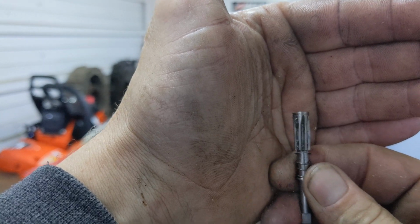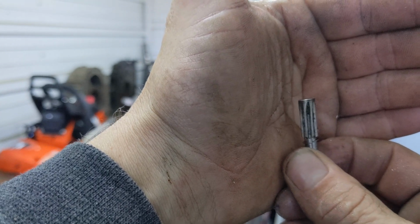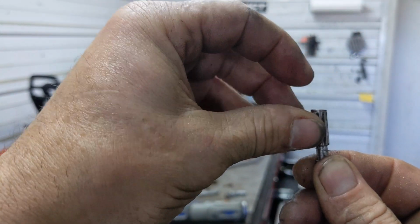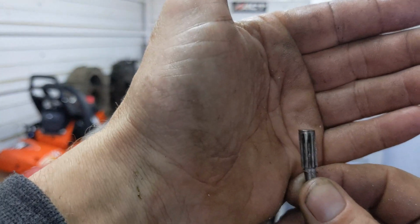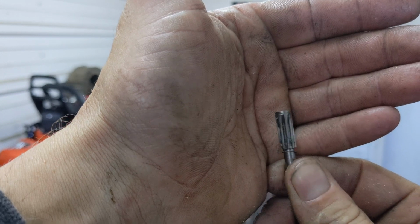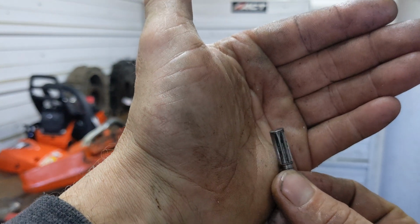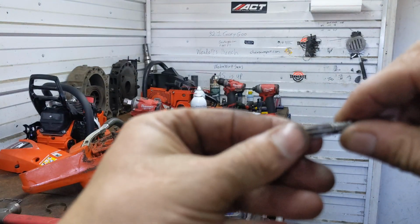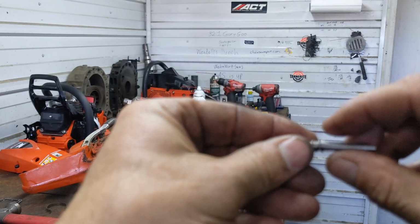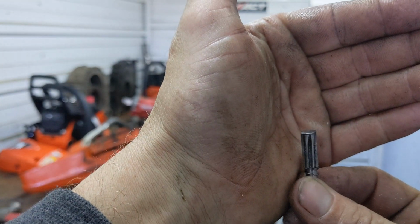take much. Probably turn this into a drinking game if I take a shot every time I say very little does a lot with an oiler. But you want to make sure that taper is super smooth and there's no hindrance on there. So when you put this back together, rotate it with your finger and make sure there's no catches. That has to glide perfectly. Otherwise it'll take out your worm gear or the oiler in general, because if it catches, it wants to flex this like so, and that's hard on the shaft, and it's really hard on the worm gear.